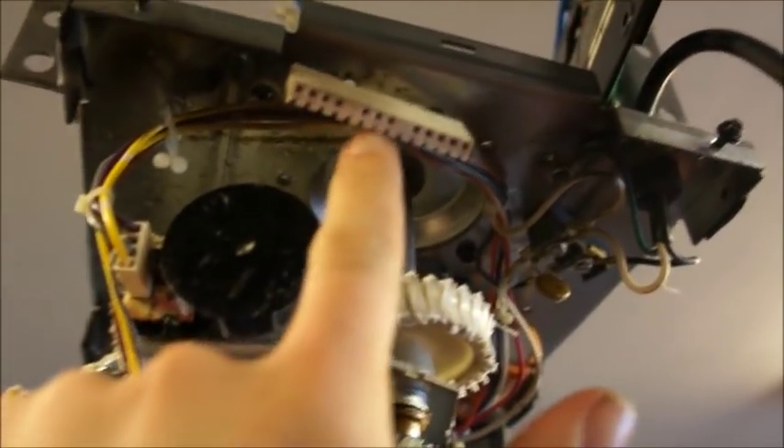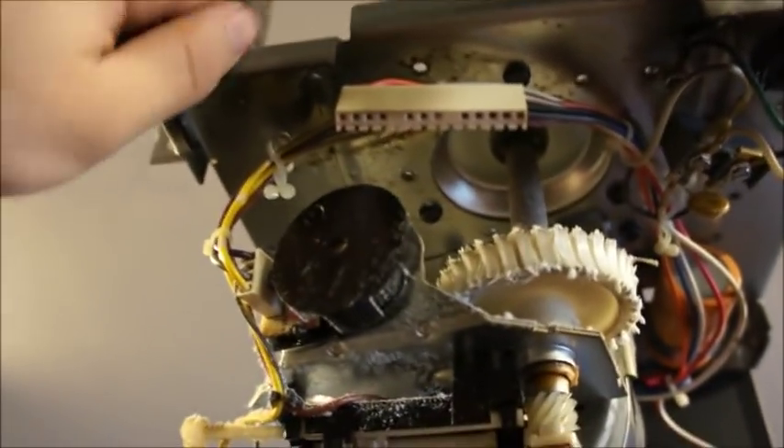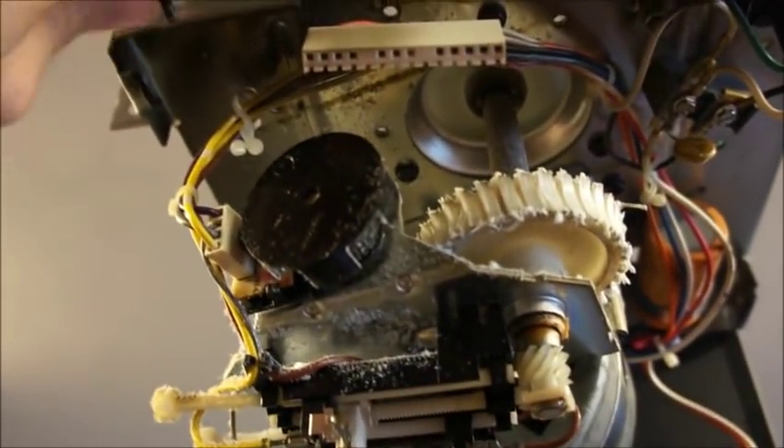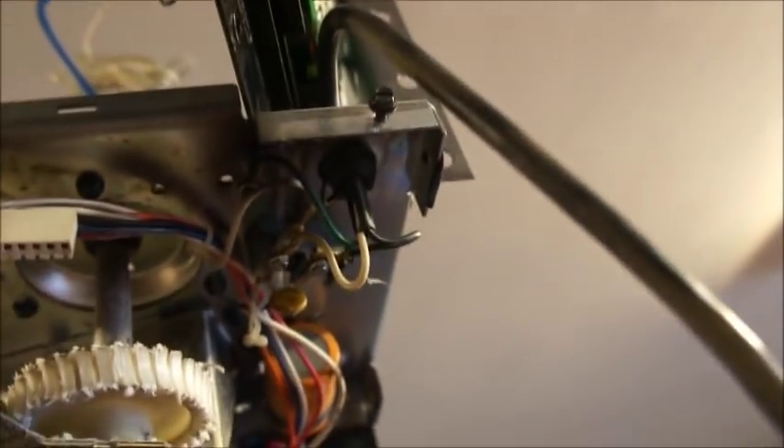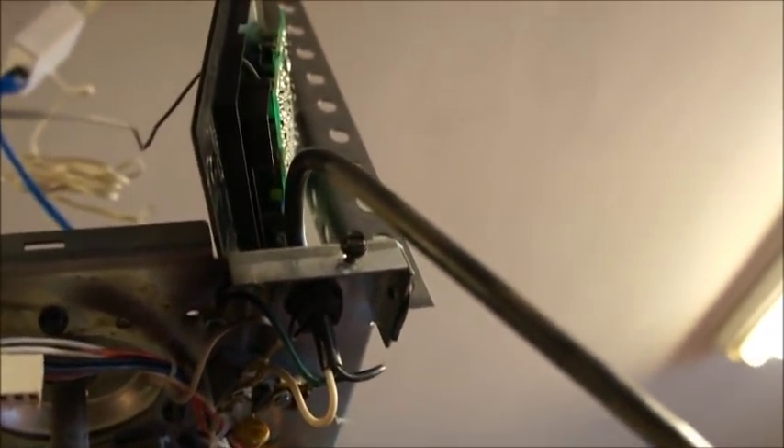You can now see all of the plastic shavings in the case from the gear that's stripped out. I removed the circuit board and placed it on top of the machine — it's two screws at the top, and then you remove this connector. Be careful not to damage the pins. It's worth noting that the screws that hold the circuit board onto the chassis have washers on them. Don't confuse these with your normal case bolts, because if you put them on without the washers, there's a good chance you can crack the plastic housing.